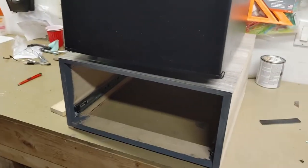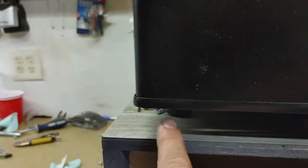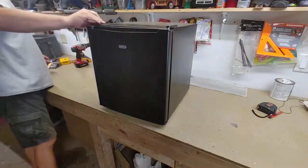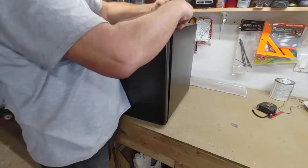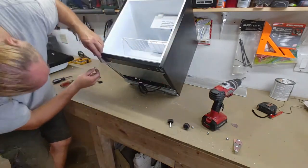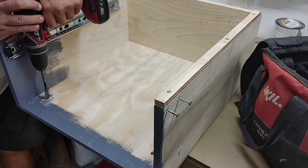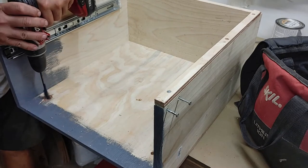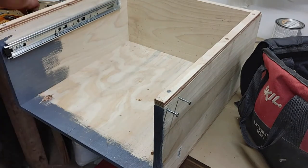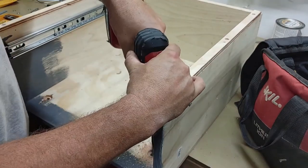We've got the refrigerator set up on the cabinet. I actually want to attach it to the cabinet, so I'm going to take out these threaded leveling feet and replace them with threaded rod that will come down through the cabinet so we can secure it. The door currently opens from left to right — hinged on the right side — and we want it hinged on the left side towards the rear of the camper. Just like most refrigerators, the doors are reversible, so I'm going to move the hinges to the other side. Drilling the countersinks for where the threaded rod comes through — I'm only going to go about halfway through the plywood so I don't make it too thin. I might have to cut a clearance on the back of that drawer after everything's done.